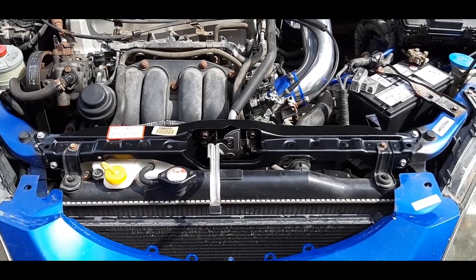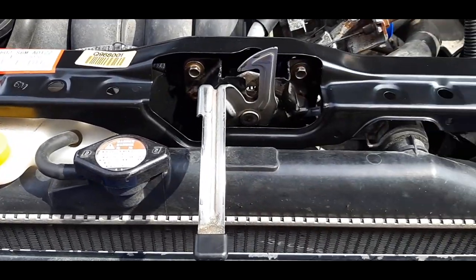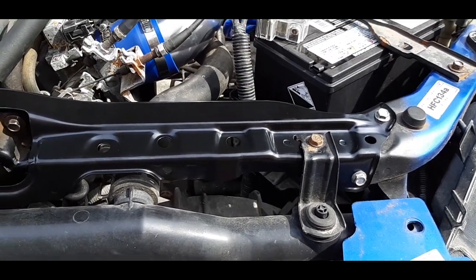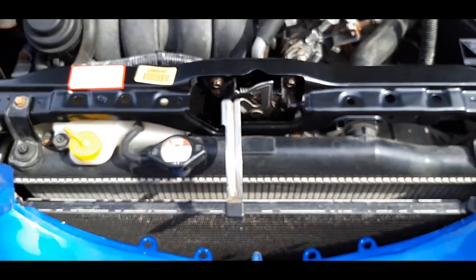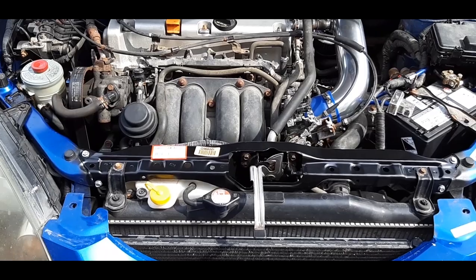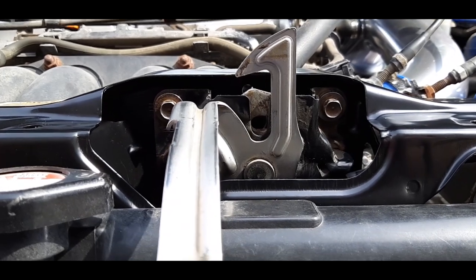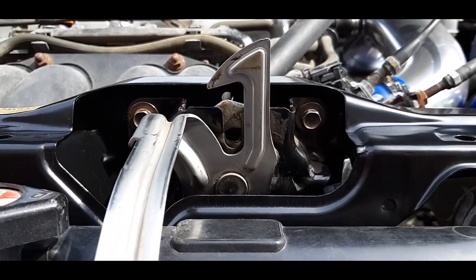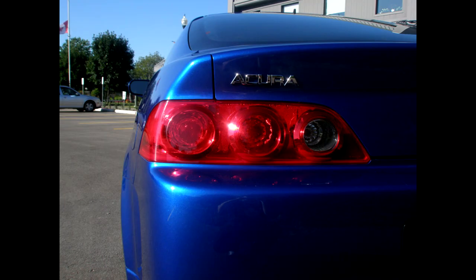All right, all done. Here's the finished product. You can see I've got it back in with the old latch attached. Just a few screws on each side, and you can quickly see if you pause it — that's the part number there with the red label, and it's looking good. I don't have to worry anymore about my hood flying up. I'm sure you've seen the dreaded pictures online. It can destroy your car, so definitely don't wait. Take your hood latch off and inspect it — make sure there's no cracks because you may not see it behind there. Hit that like button and remember, take it to the track not on the streets. Take care.